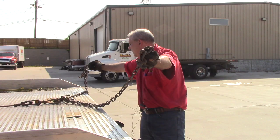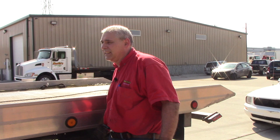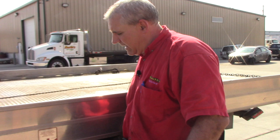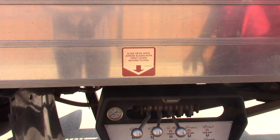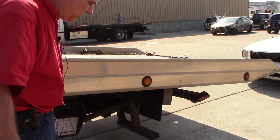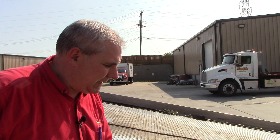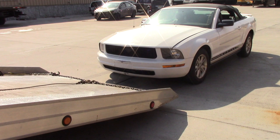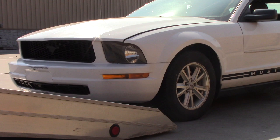My purpose for staging is that once I lower this bed on the ground, I'm not under the front bumper reaching in and trying to get to it — I've already got it there and it's waiting, easy to get to. I'm going to roll the bed back until we get up to the alignment step. There are locks under the front of this, so when it comes down flat it locks in there. I'm going to wait till that bumper's just about on the ground — on this truck it's adjusted really close. That way when it's down it gives me more stability, wheel stability plus frame stability.